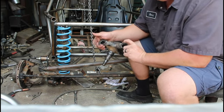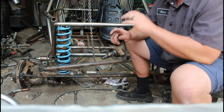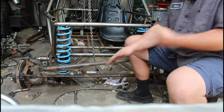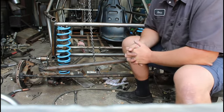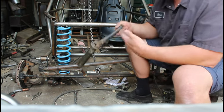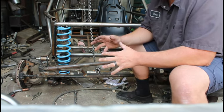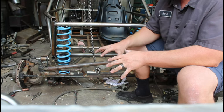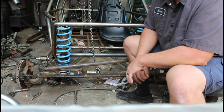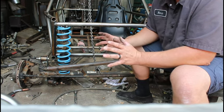Admittedly, your link pin bushings wear out really quick, and you always just have this front end wobble. No matter how much you tighten it, you always have this front end wobble. The only way you can get rid of that front end wobble is to go to a stock length, because they don't wear out near as fast when the link pin is in its stock configuration. That seems like a lot of nonsense that doesn't really explain why I put a beam from a two-wheel drive XJ Jeep underneath here. I mean, it doesn't seem to make sense.